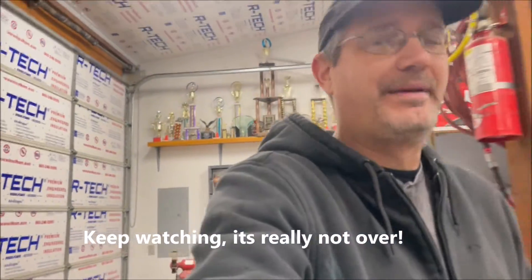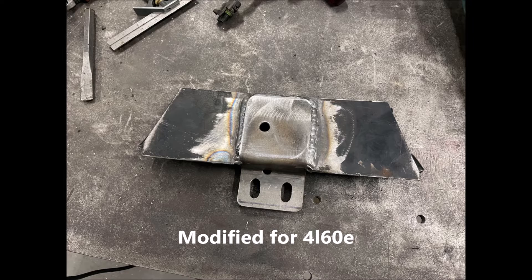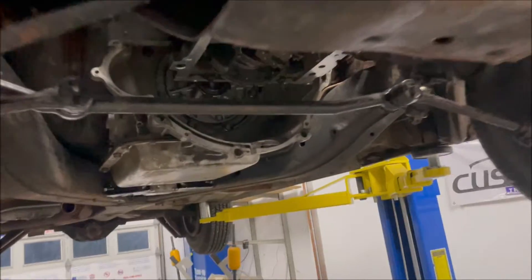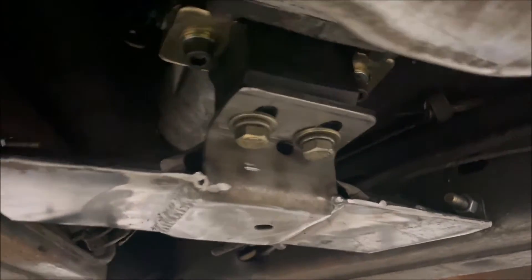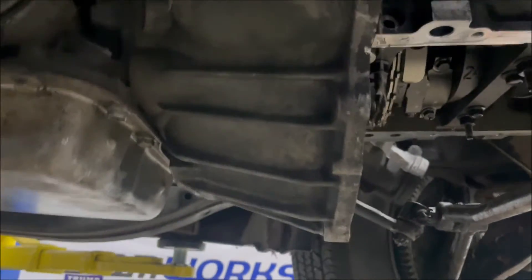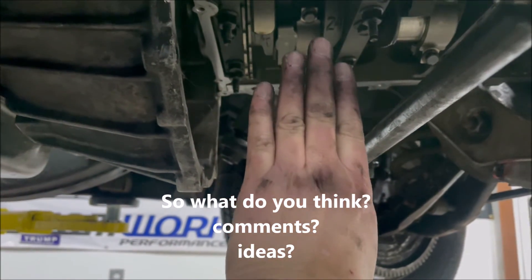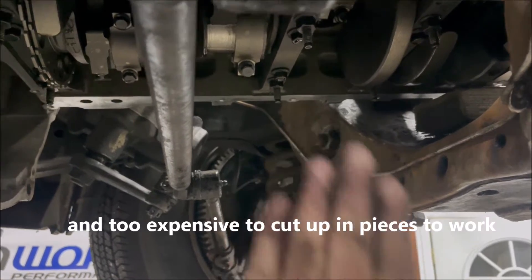We'll keep you updated. Hit the like, subscribe, comment — any suggestions. Next step is we're going to get the engine and transmission secured. So we've got the transmission crossmember done and squared away. Everything looks pretty good. The transmission is really tight in the tunnel — this tunnel is pretty small. We actually moved the engine back an inch because we need to fit an oil pan sump in here. We tried finding a mid-sump pan, but there's one out there that's just a little too wide and it was going to be too tight.